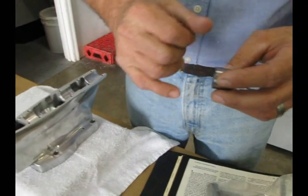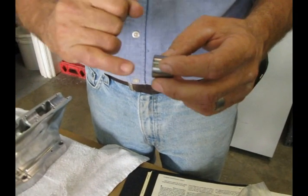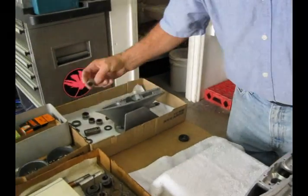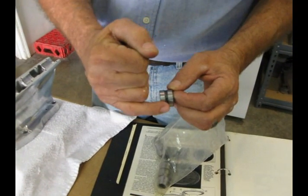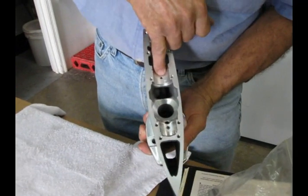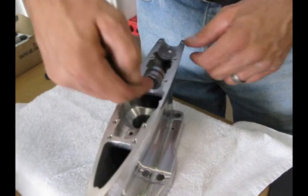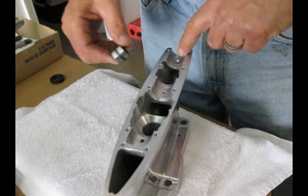What happens is this: the theory is we'd like to get oil down the shaft and actually spin it centrifugally through the outside. So what we did is we found bearings like this — if you notice, it has an oil race around the outside. Then we drill a return for that race. So when that bearing sits in there, when we take oil down it, it centrifugally forces the oil through the needles and back down that return.